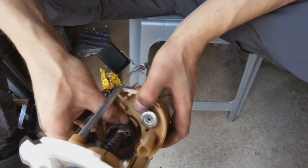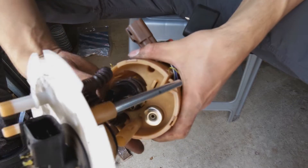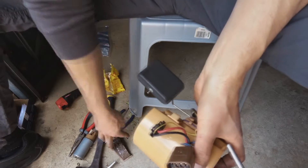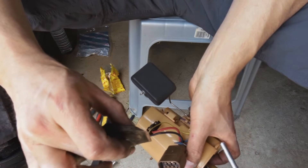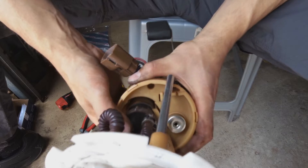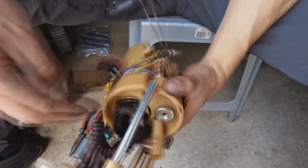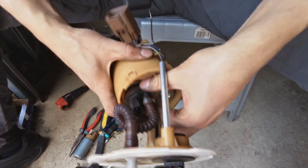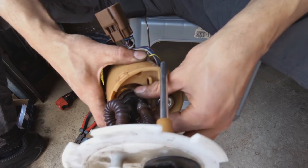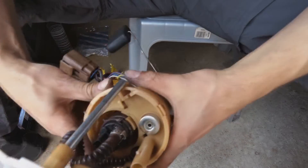It's actually not necessary because I'm now going to clip it onto the pump body itself. The reason is that the profile of the filter of the original was thinner than the replacement — the Bosch replacement. Therefore, I needed to actually lift this filter a little bit, and it does seem to work. This seems to be a universal spacer because there are different heights to it, so maybe it can accommodate different sizes. We don't actually need this spacer here, but I will just leave it in — it's not doing anybody any harm.